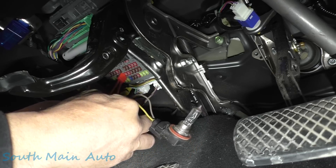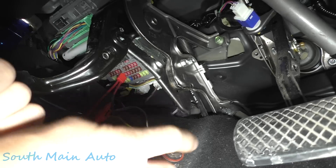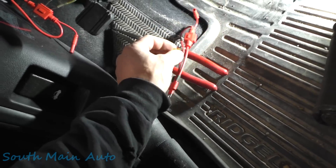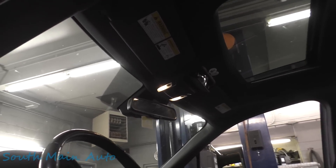All the lights are on — it must run a relay. There is no short currently because our light is not on. However, our interior lights are on. So what's that tell us? That tells us that we're dealing with a dreaded intermittent. However, we've got to look at a wiring diagram. I can tell you this — I have a small amount of experience with dome lights blowing fuses intermittently.